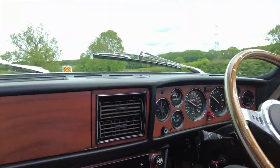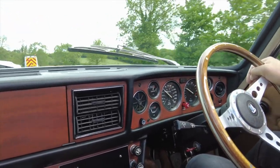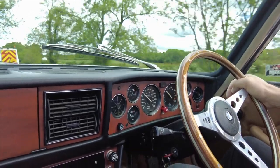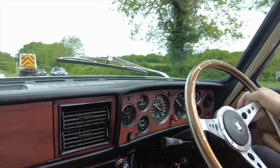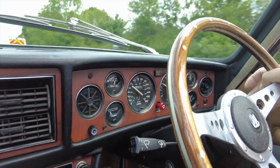We will get off this road in a minute, and I mean, overdrive is... That's fourth overdrive, and you heard it drop. Yep, that's great. We'll go back out again. That dropped down to 2,000 RPM at 50 mile an hour. We'll do it again. We're left, shall we? Ready? There you go. And it's seamless, kicks in straight away, that's brilliant.